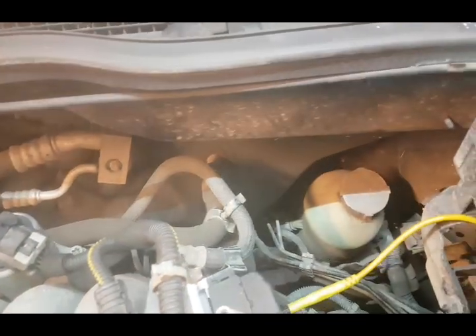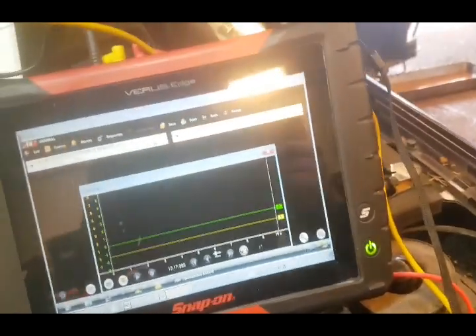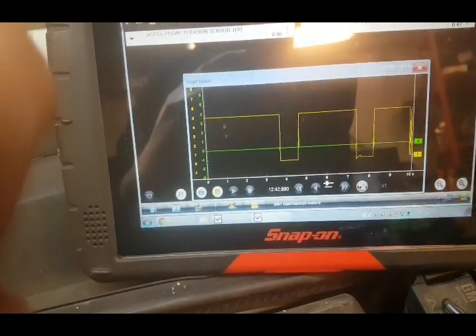The other one is pin 50. I'm going to have to pull it out and have a look to find where pin 50 is. We know where our pin 50 is now. Just make sure our connection is still good on the live one - we go in. I'm out of it, I'm in it. That's both earths checked. The ECU is earthed. Just checking now on the body of the ECU - that's me shaking it about, that's me just on the body.